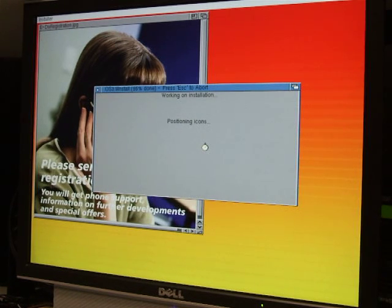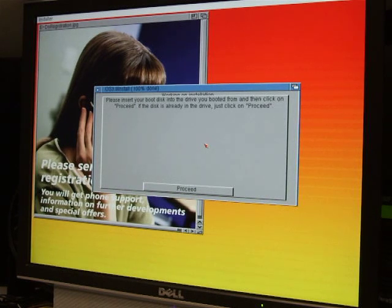One other thing I didn't go over was in HD Toolbox. One of the other parameters is to set the number of buffers for each new partition. I didn't even look at what the default was. It was probably 80 or 50 or 100 or something. You can always go back and change that. I just wanted to point that out for somebody that has never installed Workbench before, that one of the parameters they might want to adjust is the number of buffers. Obviously, the more buffers you give it, the better your performance, the more memory it'll consume. So it's a trade-off. If you have something like one of the new ACA accelerators with 128 mega memory built in, not so much a big deal. But older systems, maybe you kind of want to balance.